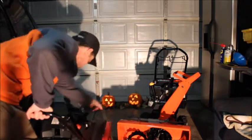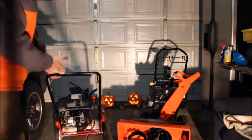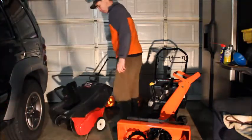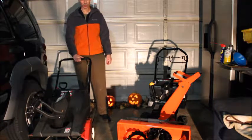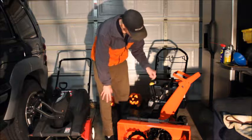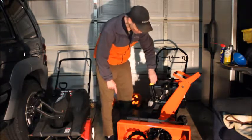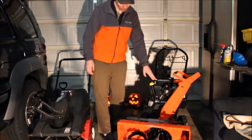The unit is very clean — I'm going to be selling this soon. I've been through this machine: the carburetor has been cleaned, the oil's been changed, the spark plug has been changed. When I get into units I go bolt by bolt, very detailed. What are things you look for when buying a snowblower? A lot of types are going to tell you they changed the oil. In this case the bottom of the dipstick was black — the previous owner said the oil was changed, but when I drained it, it was black.